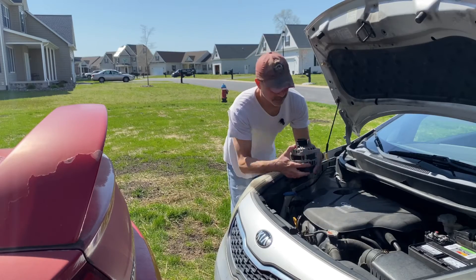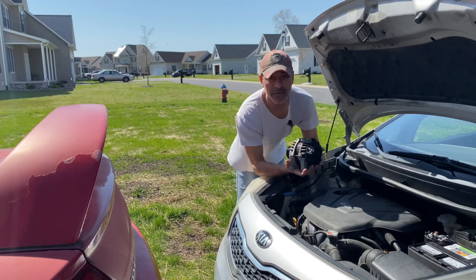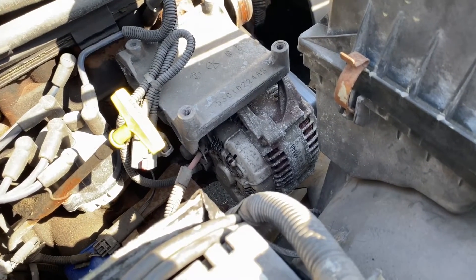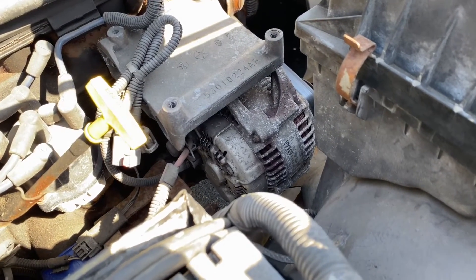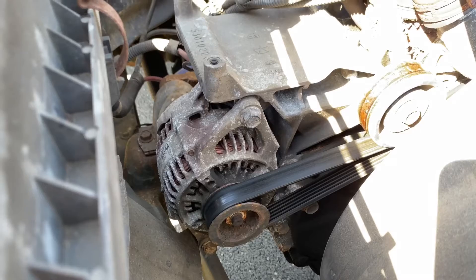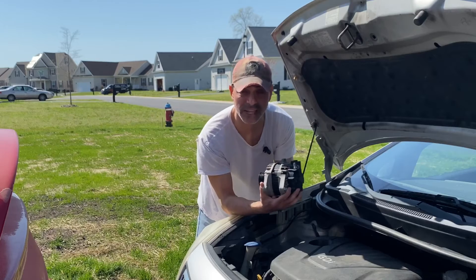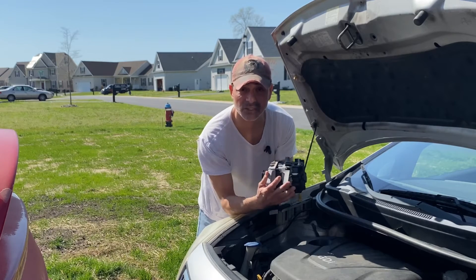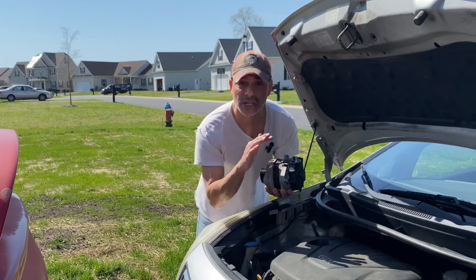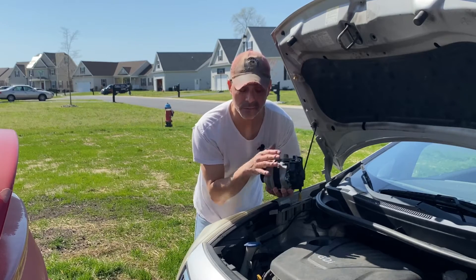This is our alternator, and this is where it slides onto that mount and then the bolt goes through it. It's not uncommon to have vehicles that are mounted directly to the engine block for the ground. Here's another vehicle which is a Jeep Wrangler TJ — you can see that one is also mounted to the engine block for its ground. If you've been watching my channel, we had some issues with the alternator to begin with and it failed. We replaced it and then started having these issues.